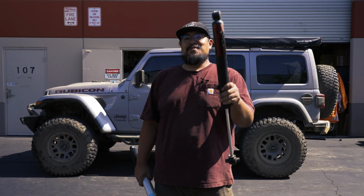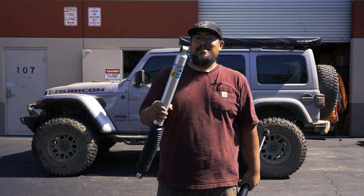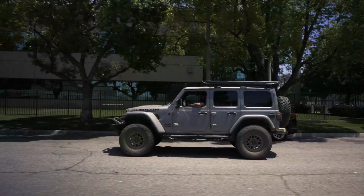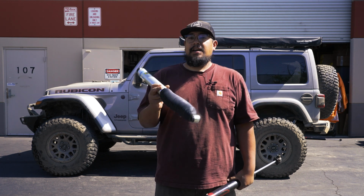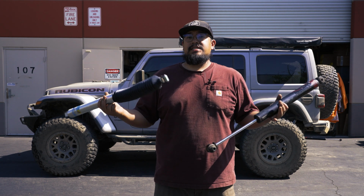All right, Rancho RS7 MTs are off of the Jeep, and the Bilstein 5100s are on there. We took the Jeep around our block for a quick little test drive to let you guys know in this video what they felt like. Was there a difference? There definitely was. Bilstein 5100s had a little bit more compression and rebound damping. And what does that mean?